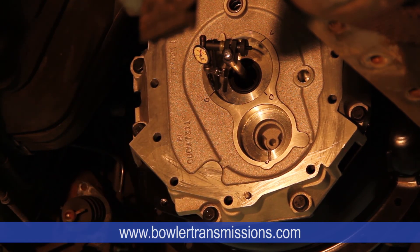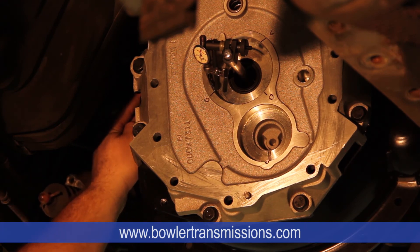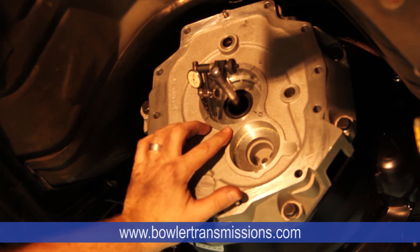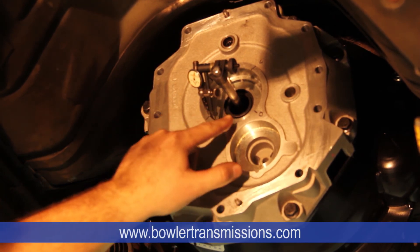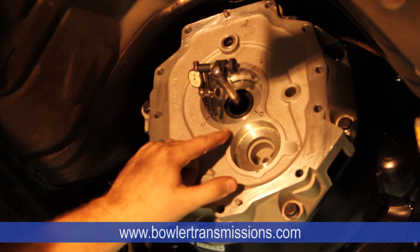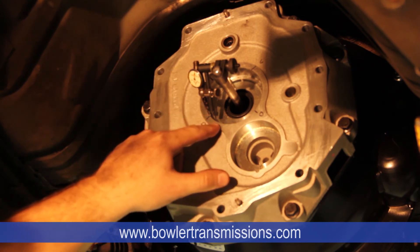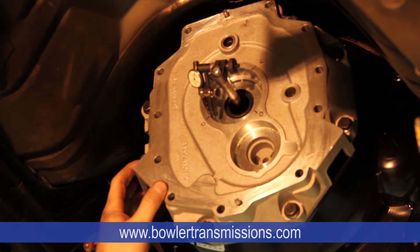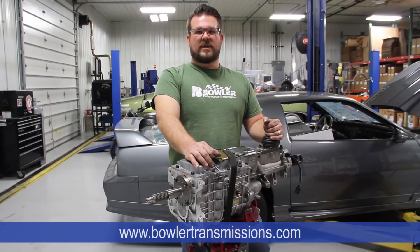We've got no more than seven thousandths total on all those sweeps, so we fall into range and will not need to use any offset dowel pins. If yours falls outside the ten thousandths range, they do make offset dowel pins to locate your bell housing onto the block, moving the bell housing left, right, up, or down whichever direction you need. One important thing to mention: when running your dial indicator sweep around this bearing race, there are two slots — one here and one opposite — that you have to be careful of. When the end of the dial indicator gets there, lightly pick it up and let it ride across, then set it back down while you're cranking the engine in the rotational direction.